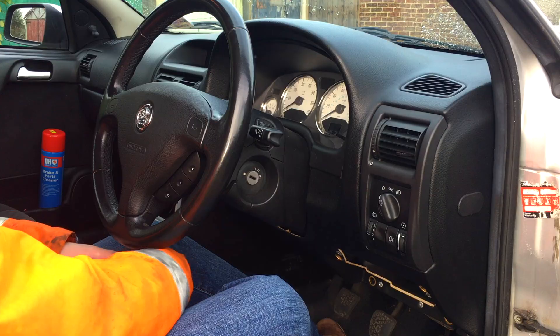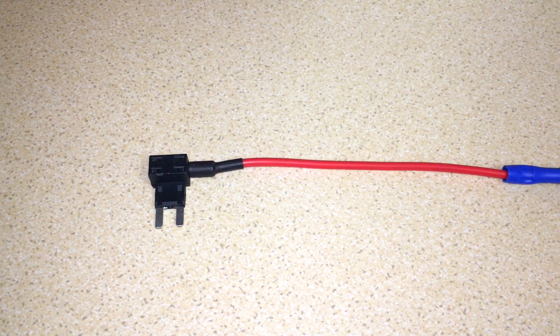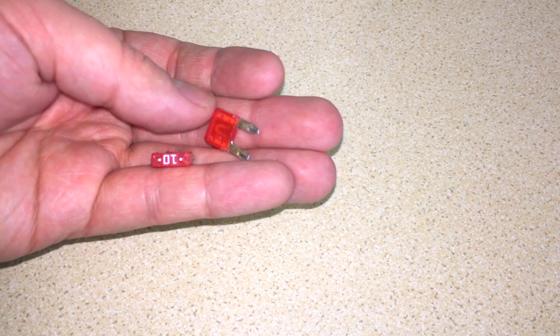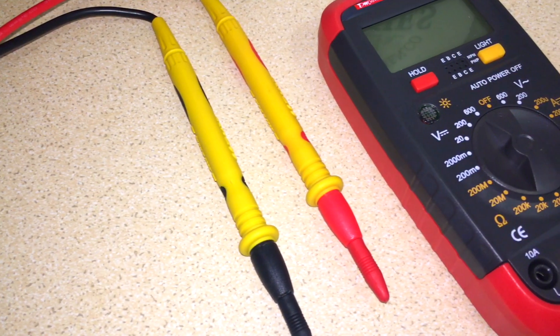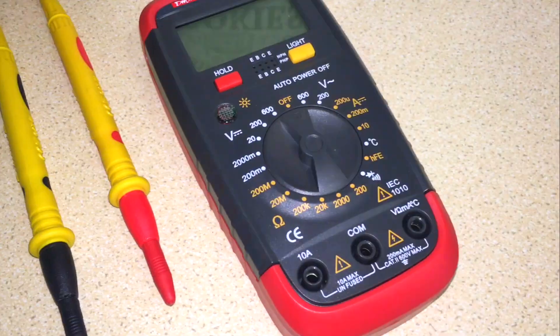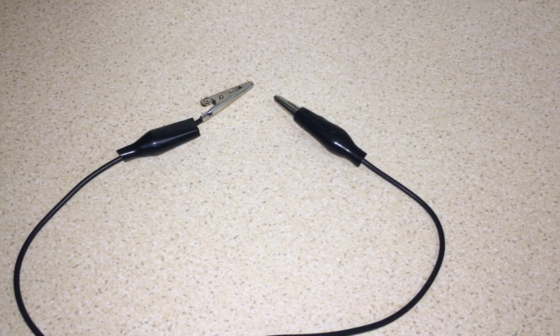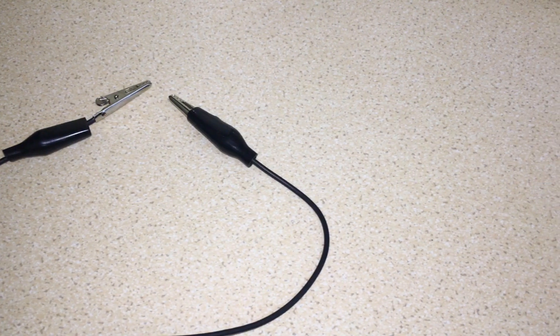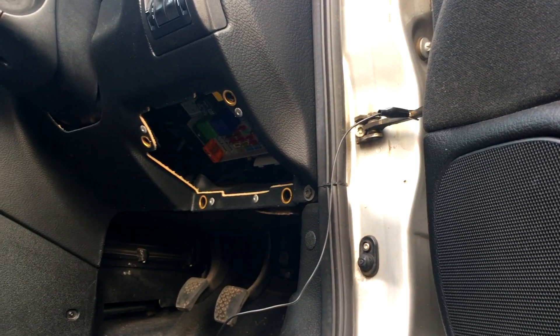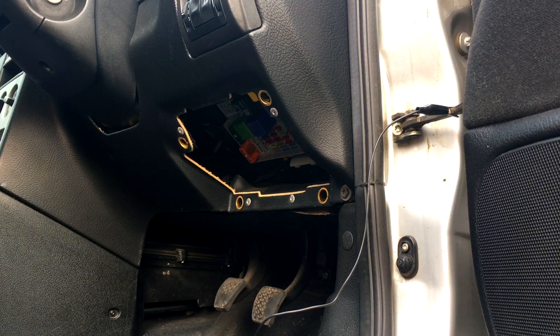The equipment we need is quite simple. We're going to need a piggyback fuse, which goes into the car's fuse box and gives us a second live to come off. We'll also need some appropriately sized fuses for the piggyback fuse, and most importantly a multimeter to test where the voltage is coming through. Finally, although not necessary, I like to use crocodile clips on the test points to make it easier rather than having to hold terminals with both hands. Any products I use in this video can be found in the description below.